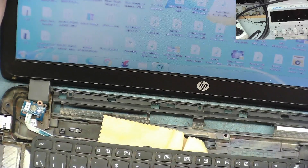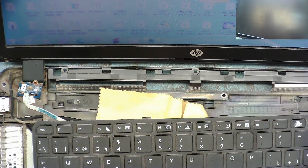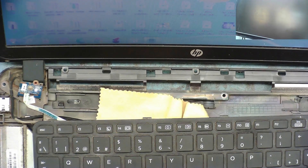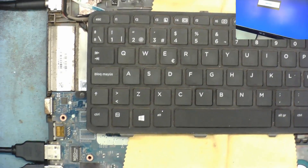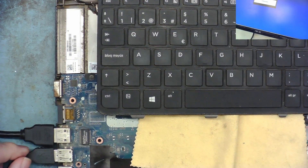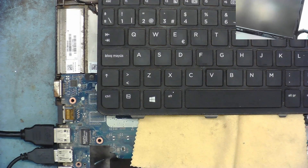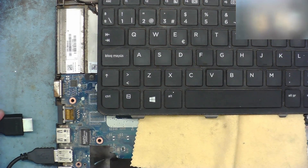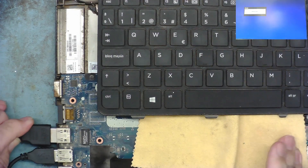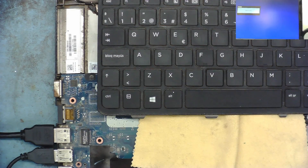I have it in Windows now. When I attach the HDMI cable — unplugging and plugging it back in — I get a blue light on the monitor but it says HDMI no signal and then the light goes off. I've noticed the USB is a little bit dodgy. I had a USB keyboard plugged in but couldn't enter the password because it was set to a Spanish layout and I had an English keyboard. The main problem remains: no HDMI output — this was the original fault before it went completely dead.